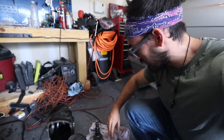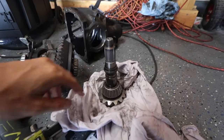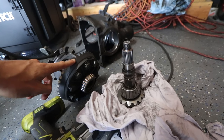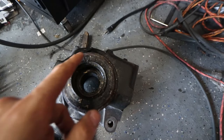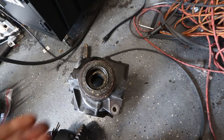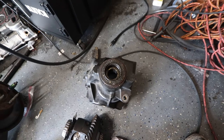Welcome back to my happy place, AKA the garage. I got this thing all torn down - got the other pinion and everything out of here. I just finished welding this thing up not too long ago, and this is our old pinion that we got pressed out yesterday. We got a new one and it's going on. I got to get these bolts off so we can get this ring out of here, put the new ring on, then work on installing the new pinion. But before we do that, I've got to change out this seal here because you can see it's a little wet and it was leaking. Also this is 280,000 miles, so I want to take care of it while I'm here.